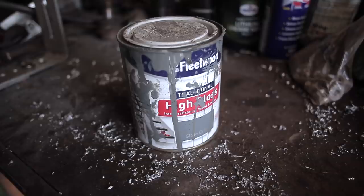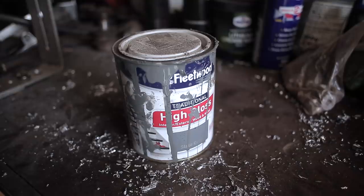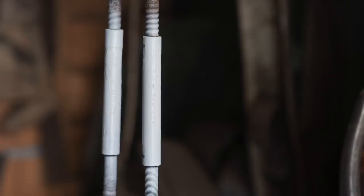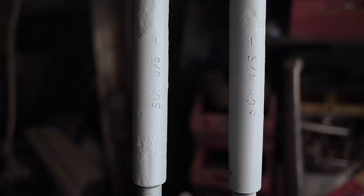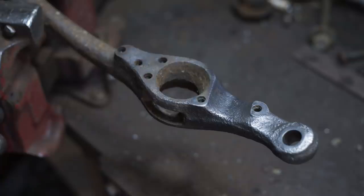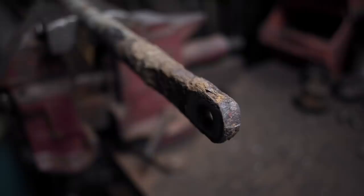And once I've given at least two coats of that, I just hit it with whatever oil based top coat the hardware store has in stock. Like I say, not a paint expert. If I had my way, I would do everything the way the Esprit chassis has been done, and I would epoxy prime before doing anything else. And that is what eventually I will tool up to do. I have treated all of my builds so far as an experiment in that regard. And that's the reason why the last section of paint you see on this car is Battleship Grey Gloss. Running low on supplies, that is all I could find in the shed. Copy my paint regime at your own risk and discretion.